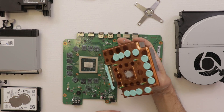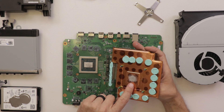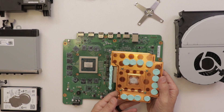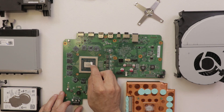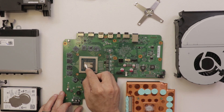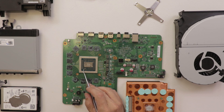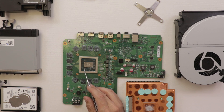Here we go. There's the liquid metal — I don't see any initial damage. I do need to get it all off and then have a closer look. You can see some of the little liquid metal specks down in here. I'll clean those off. I'm not too worried about it — I did put conformal coating on all of this so it's not going to reach any of these chips, but I will clean it off anyway just to make sure it doesn't get anywhere it's not supposed to be.